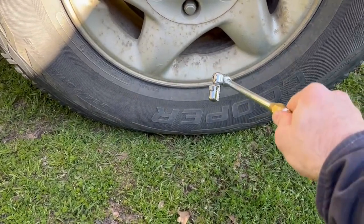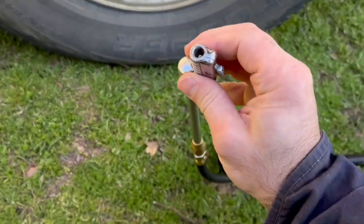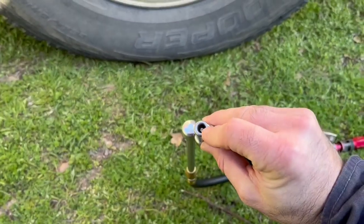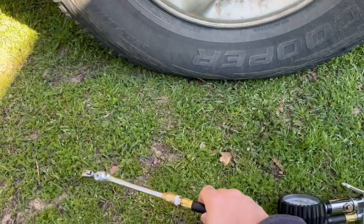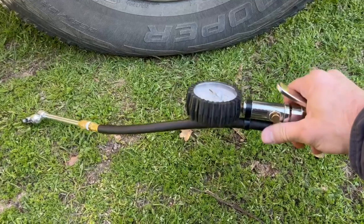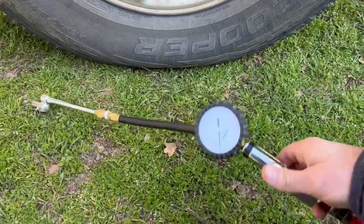Hook it on and it locks — and that's what I like about it. One thing to keep in mind: this is an open flow, so what that means is this head itself doesn't have a valve in it, but it does have the knob in there to open the Schrader valve on your tire. So what you have to do is attach this to something like this — just a little inflator from Harbor Freight. You can get them just about anywhere; there's a bunch on Amazon.